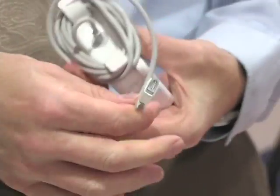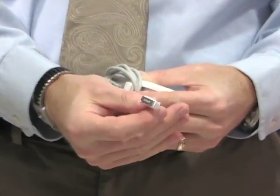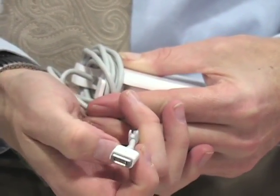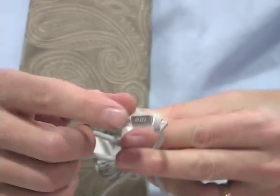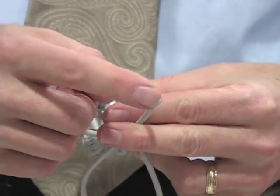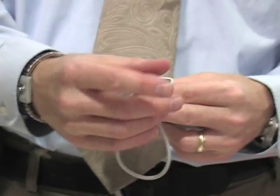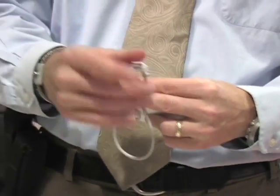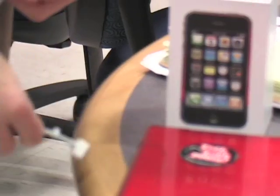Sometimes you can get some problems on this end, and you'll usually see that it'll start to get black. It'll burn sometimes. Yours looks fine. But there is a very, very powerful magnet in this as part of the MagSafe connector. One thing that you want to make sure you don't do is — some sand is actually magnetic. You can pick up sand with this and then plug it into your laptop. And guess what happens? You short it out.